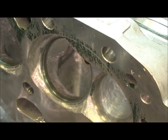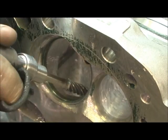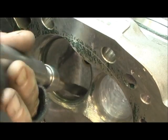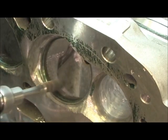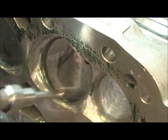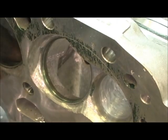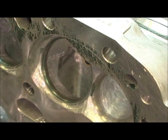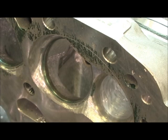On the short turn side, I've already went ahead and took a little bit of bulk material. But if we take the finger and with the blade pitch being closer, what it'll do is just kind of smooth blend it. Remember, we're not wanting to let the die grinder go into the seat or move more aluminum material so that it's got an edge — and right now it feels really good. That is a great roll right there. So that pretty much takes care of the bowl area. The next thing we're going to do is bullet nose the guide some with a different kind of tool. I'll let you see that being done — it's pretty interesting.